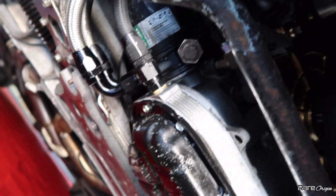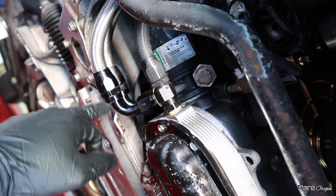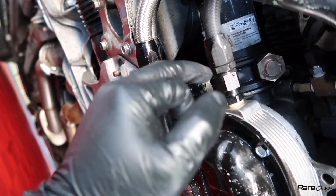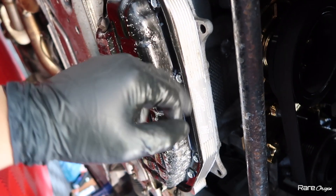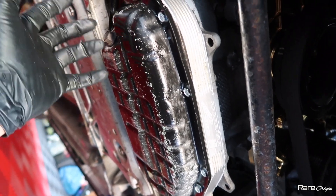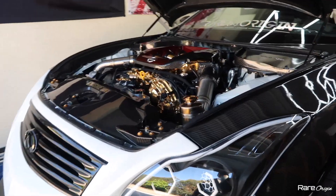So this is going to be the plan. I already talked to my mechanic — the one that took care of the turbo. He's going to take care of this. I have to bring it over to his shop; he's going to get new lines for these things and inspect everything. He also mentioned while I was FaceTiming with him that all of these fittings need to be wrapped with Teflon tape so they don't leak. He's going to remove the spacer and the oil pan, remove everything, and put it back with new silicone so nothing is leaking. I'll be taking the car next week.